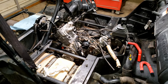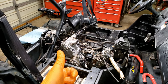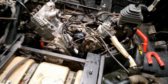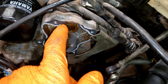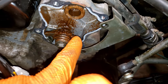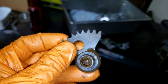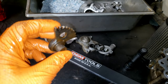I didn't read the book so I can't tell you that's the straight procedure, but I looked up the marks and that's the method I use, so hopefully it helps out. Drop a thumbs up if it did, and if I did something wrong please comment below. Quick tip: if you're having trouble shifting, pull this little cover off — these 8-millimeter bolts. My gears were so rusted and chewed away I ordered new ones. That's what the gears are supposed to look like — mine were worn down to nothing. It's about 40 to 50 bucks for two new gears from Yamaha.